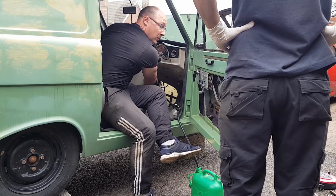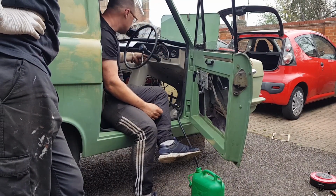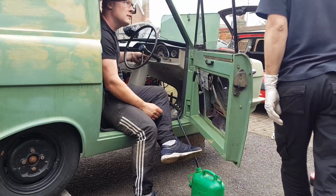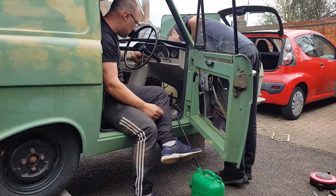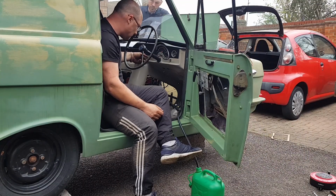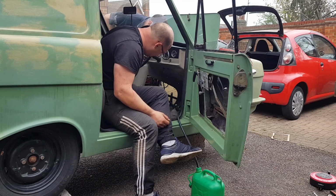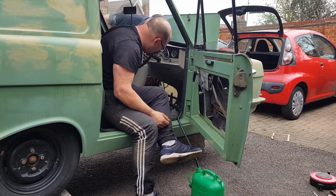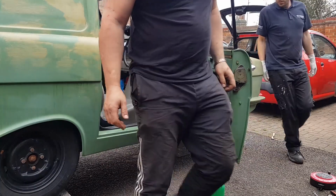Well, it's got the points. The points weren't cleaning. Yeah, it's weird because I had it running before though. That was over a year ago. Looks like it's over fueling. Probably. I reckon have the cap off and clean them points up. That's what I reckon. We're going to do a bit more investigation, we'll come back to you.